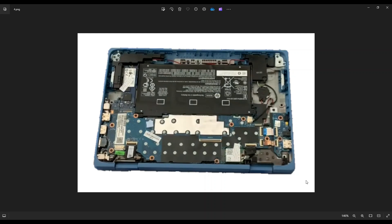Now as a general computer repair side note, whenever I'm working on a computer in my shop, it's sitting on an anti-static pad. Either that or an anti-static bracelet are great ideas to avoid damaging things in your computer when you're working on it. If you guys need any help with tools and supplies, as well as any replacement parts for this specific model computer, there'll be a link above and also below in the description that takes you to a list of all those tools, supplies, and parts for this specific model computer.